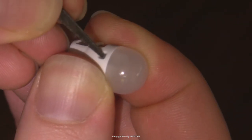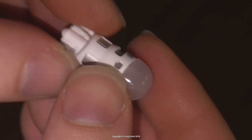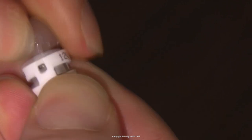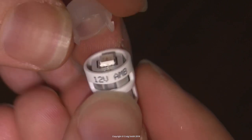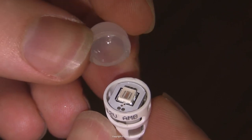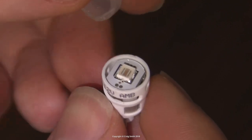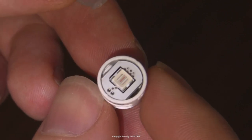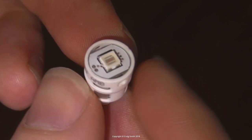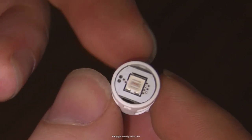Talking about the chip — the diffuser cover is easily removed. You can just prod its clips inward like so, and it'll pop off. There you can see the LED naked. If you installed it like this, you would lose the benefit of the diffuser obviously, but it would be a little brighter and it would also fit more easily if you have a tight space. I would use it without the diffuser if it's going behind an existing diffuser lens, but if it's going behind a clear lens, I would leave the diffuser on.